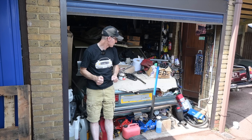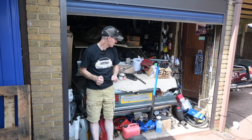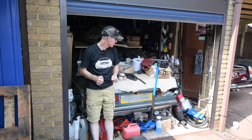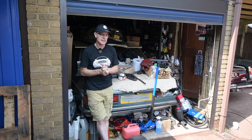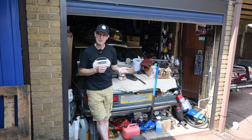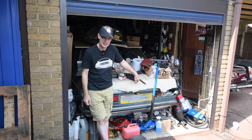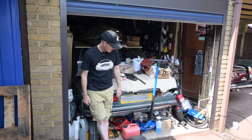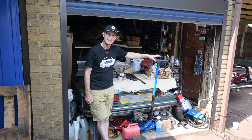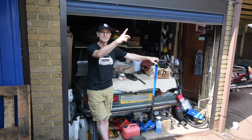Our most recent adventure with the W123 was back in December, so it's now August - that's well over six months ago. End of last year I'd been stealing batteries out of other cars, and whatever battery had been in this - I think a good newish one - got taken for something else. I got a new YUASA 075 into this, so it cranked like crazy and would have gone like stink, except I couldn't hear the fuel pump clicking anymore, which is what we like to call a problem. So first things first today: I'm going to try and reach the fuel pump, which is just inboard of the back wheel, and do the old-school approach - hit it with a hammer.